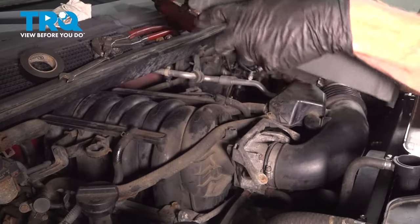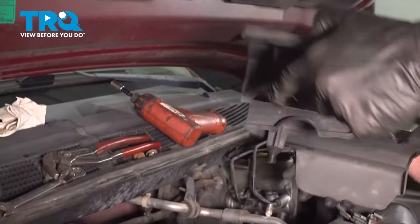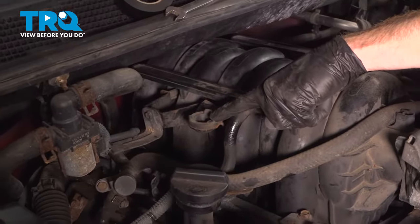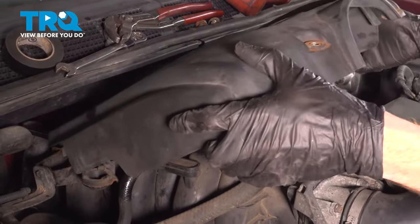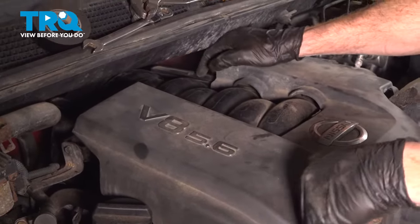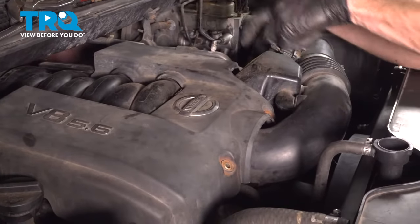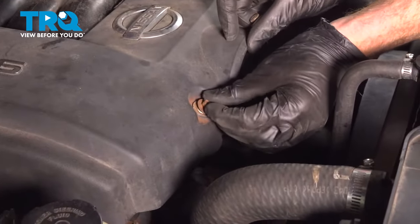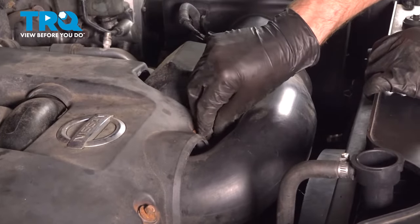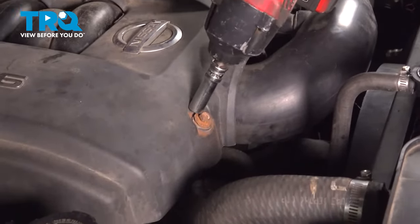Time for the upper engine cover. Have a look at the bottom side — you're going to find that you have two little tabs that protrude down. If you were to look at the top of the air intake, you'll find the ports for them to slide down and into. Let's carefully put this in position, line those up, and press them in. Continue on with your two 10 millimeter headed mounting bolts in the front.